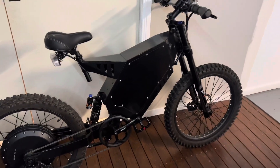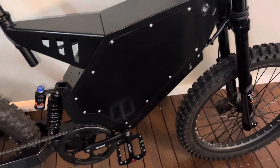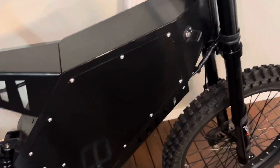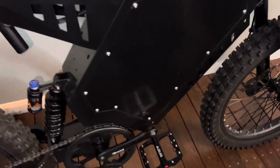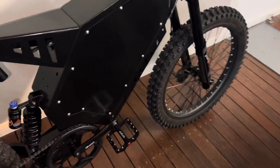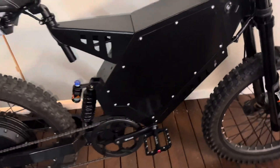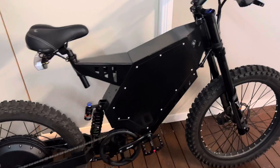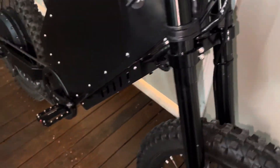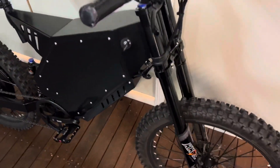That's it everybody — nice little tidy-up on the wiring, some new foam on the battery. If anyone's got one of these or is thinking about getting one, keep an eye on water inside that case. Mine wasn't even that old and had a little bit of rust in there. Repainted it, tidied it up, put some new foam on the battery so it doesn't move, tidied up the wiring harness. Just keep an eye on that — make sure it's not rusting up. I've put some tape around the battery top and bottom so it doesn't get water into the actual battery itself and start rusting. Put tape around all the connectors, and every couple of months just take it off, clean it up, make sure there's no dirt or water rusting things out.